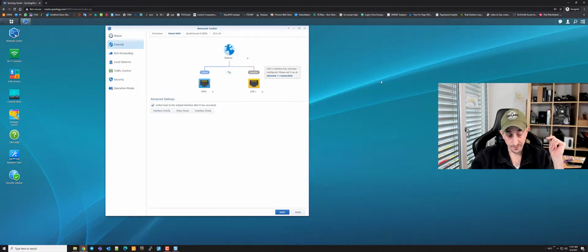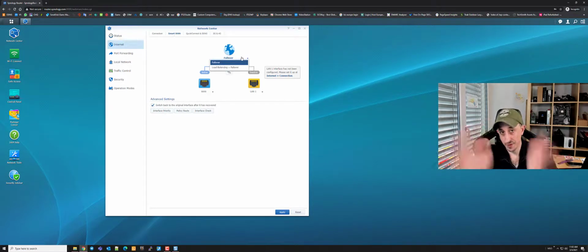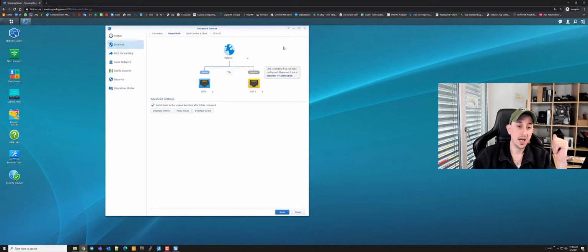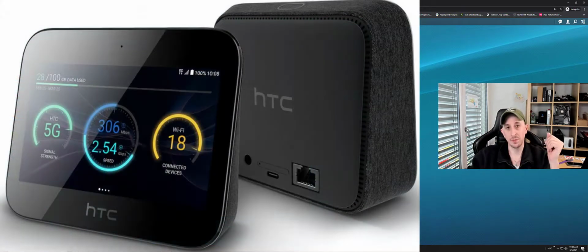Smart WAN. So, self-explanatory, failover or load balancing. Load balancing for traffic, or failover, if one line dies, the other one takes over. I have a device like a phone, standalone battery. It's got a power cable, takes a SIM card, connects to our 5G mast outside. So if my line goes down, the cellular network just fails over and connects directly to the cellular network, and it's done so on LAN port 1. It's not connected at the moment because while I'm doing this, the wife is using it to do her work, but that's where I would connect it.